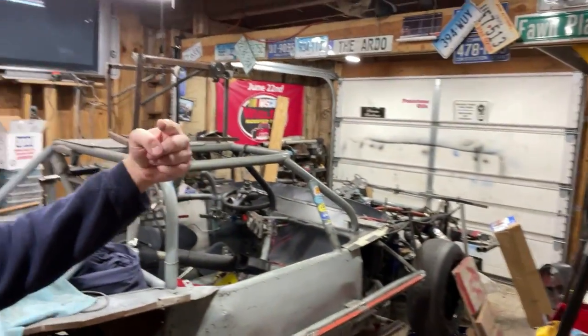So we're at a point where we could probably clip the car without a jig, but do we want to? You know what I mean? It would probably come out fine if I just do it by measurement. It would take a lot longer. But if I build the rack, then I know that I'll have something flat and level to put the chassis on. At the same time, I have to strip the entire chassis down to nothing. I would need that engine out of here so I can put this engine in here.